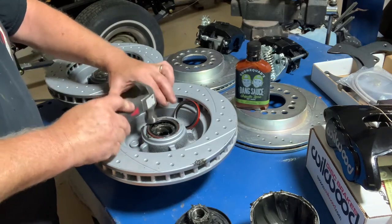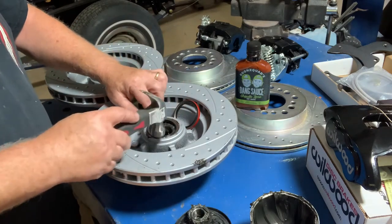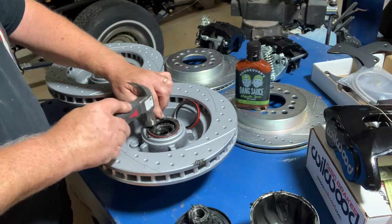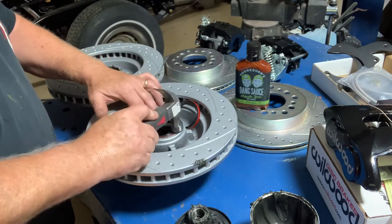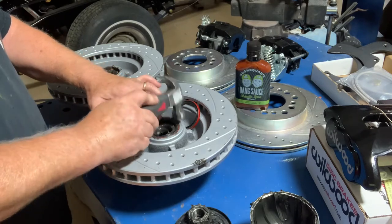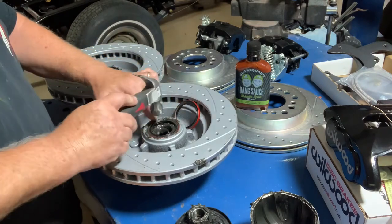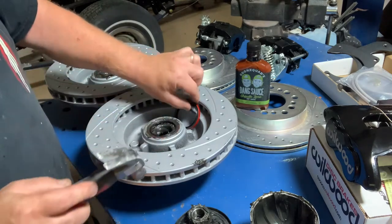You don't want to hit it too hard. I'm just barely tapping it and it's down too far on one side and up too far on the other, so we'll start over. When you hear it ringing loud, that means the seal is even with the rotor. Don't try to tighten the spindle nut to press it in straight — you'll crush it and not know it. Alright, got that one done.